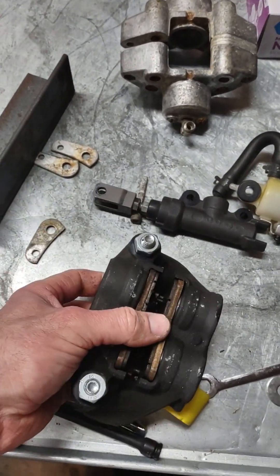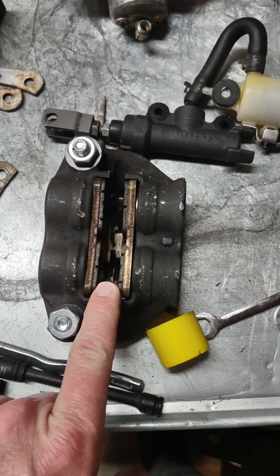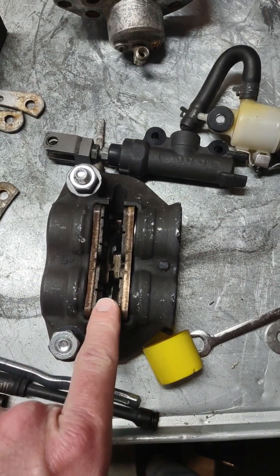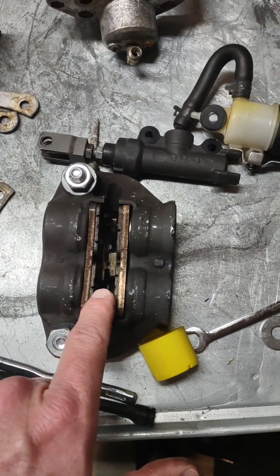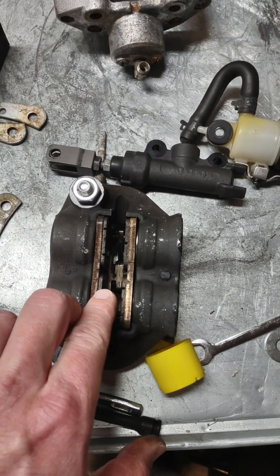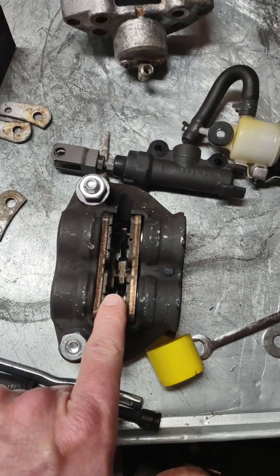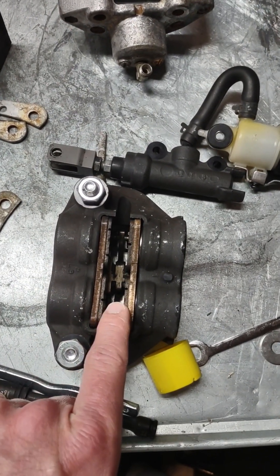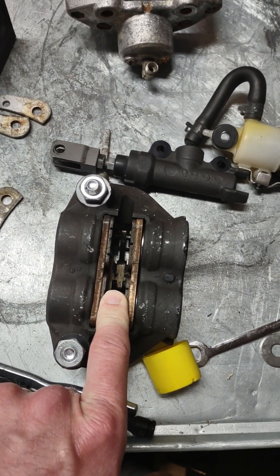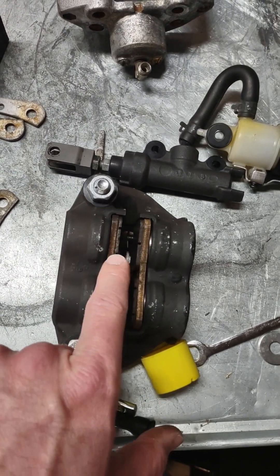The rotor that I plan on using will be a quarter of an inch. I used a caliper gauge to check the distance in between here, and I did go online and look at the brake thickness — the pad thickness is roughly a little over four millimeters with new pads, so the maximum rotor that could fit in here would be a quarter inch, which is what I'm going to try to use. The stock-sized rotor on a street bike CBR 1000 is probably going to be more like 3/16.